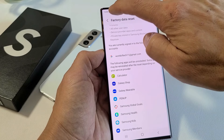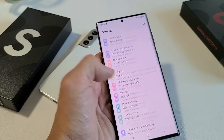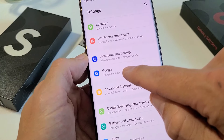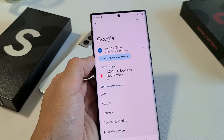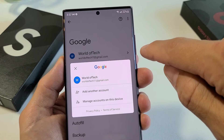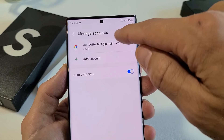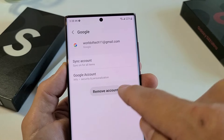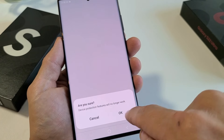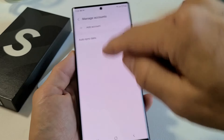Go ahead and go back to the Settings menu. Scroll down to where it says 'Google' — Google Services. Tap on that, and I can see my email address is up here. Tap on the right arrow, then tap down here where it says 'Manage accounts on this device.' Here's my Gmail address — tap on that, and now we can go ahead and remove it from down here. Tap on Remove, then click on 'Remove accounts.' It asks 'Are you sure? Device protection features will no longer work' — click OK, then put in your password or PIN, tap Continue. And voila, now it's gone.